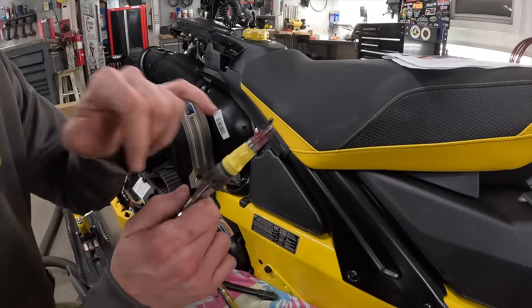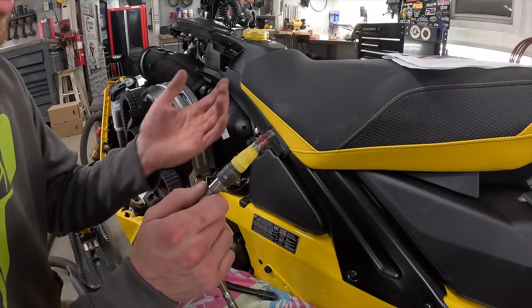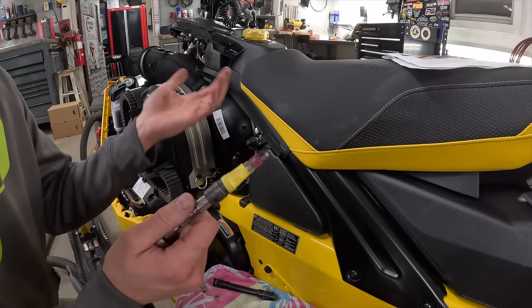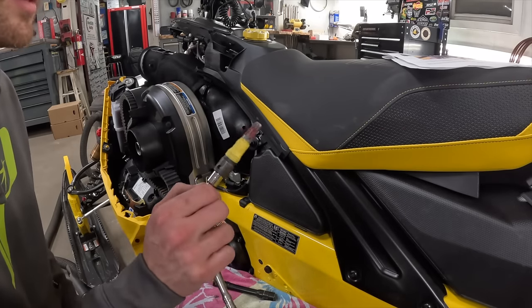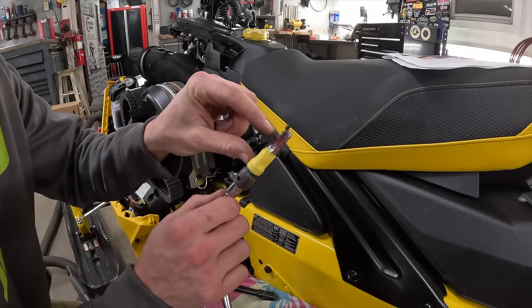The grease is also a really nice trick because, as you can see, it helps show you exactly how far in you are. Obviously, you could thread it in and make a Sharpie mark or something along those lines, but this does two things at once. It collects a bunch of debris and it marks where you are. And as you can see, we're right about halfway.